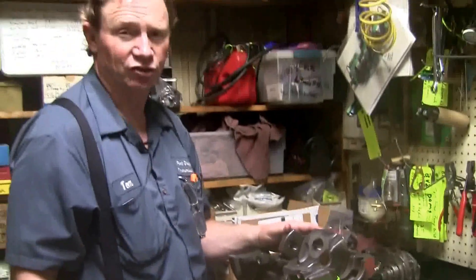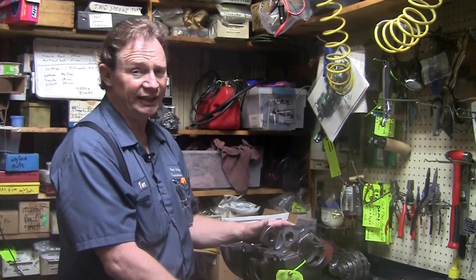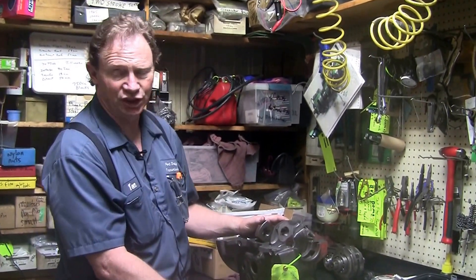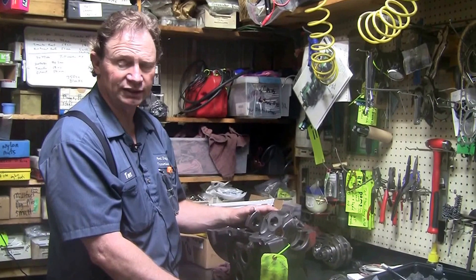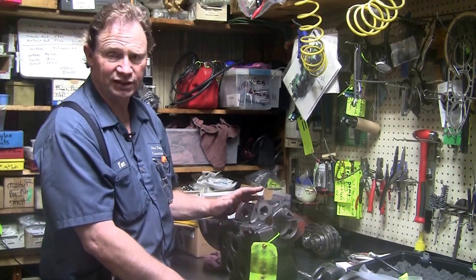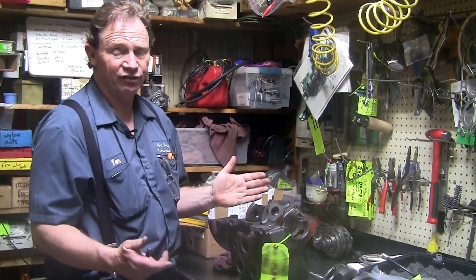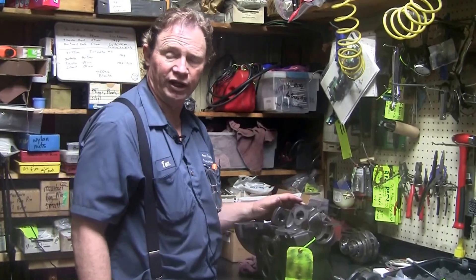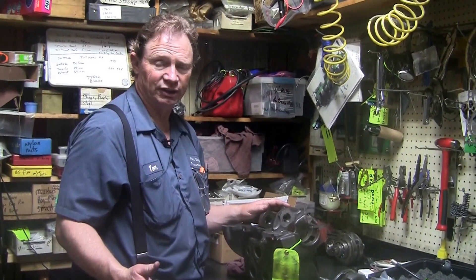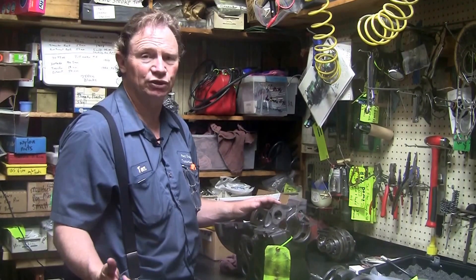You'll have to do your own testing and research for yourself. But I know for the crankshafts I build for my cars from now on, I doubt I'll build another GT Monte Carlo with full circle cranks. I think they're all going to be built as a hybrid — 50% T weight and 50% Monte Carlo GT. Plus the added benefit is you've just doubled your supply of Monte Carlo GT crankshafts and you've gained horsepower and torque. It's a win-win situation.